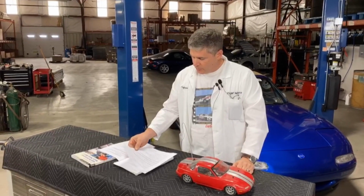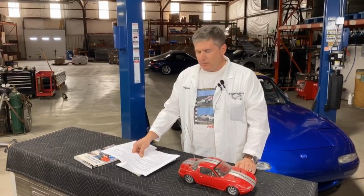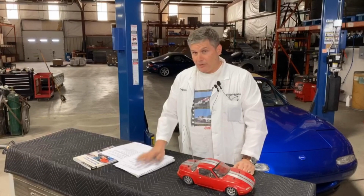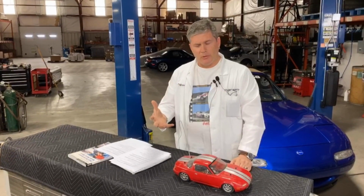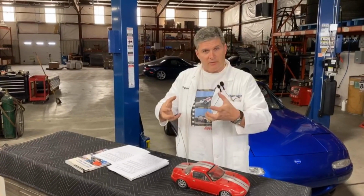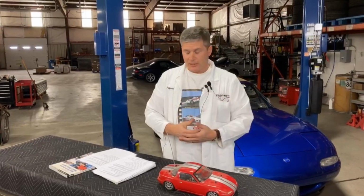What can I do to improve brake feel on a manual big brake kit setup on a Miata? I'm not sure what manual means here, but brake feel comes out of hydraulic sizing. This is always where we have to ask people questions. Is it not stopping fast enough? Like you don't feel like you're getting enough brake torque for a given pressure? That's one answer. That's brake pads. You might have to rebed the brakes. If it feels spongy, that could be old fluid.